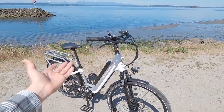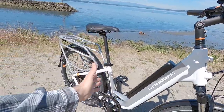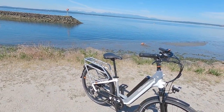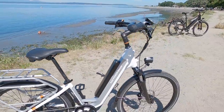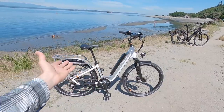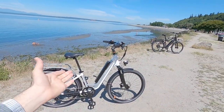One thing that's missing here are bottle cage bosses. Normally I would see those like right here, but sometimes it interferes with the seat post and how low you can go. It introduces a little bit of structural degradation. For a bike they're really trying to get stiff with these extra reinforcement points, you don't want a flexy feeling. It's tough to make a full step-through like this and still have it feel sturdy and capable.